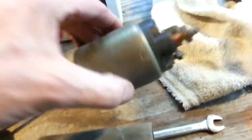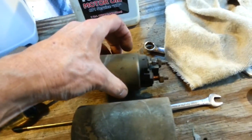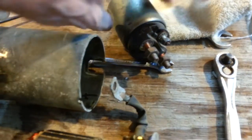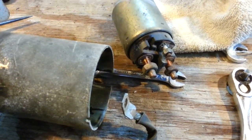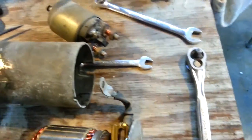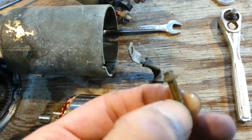Here's the solenoid, and I see there are some numbers on here. I'm going to try to get on the internet and see if I can track down just the solenoid by itself. I believe what happened with the no-start condition is that the solenoid is intermittently not making contact — could be corrosion or whatever, but after 11 years, who knows. That'll be cheap insurance — I'll go ahead and pop a new solenoid on there. Tool-wise to get the starter apart, you need a 13mm socket for the starter bolts, 8mm for all the small ones, and then that goofy E-socket to get the solenoid off.